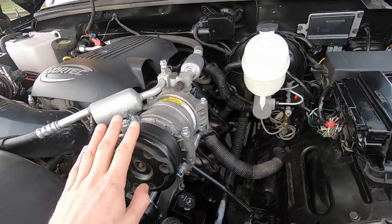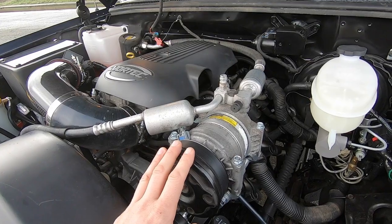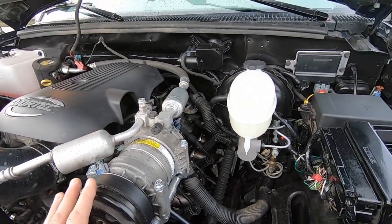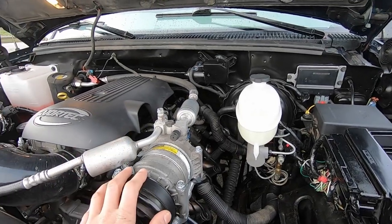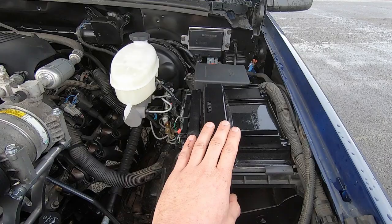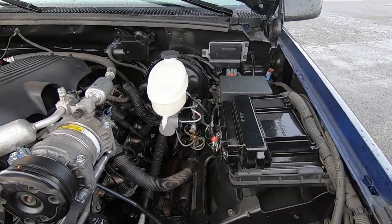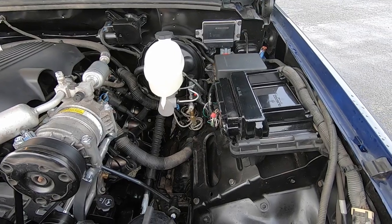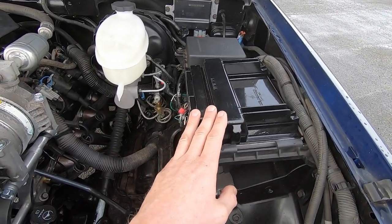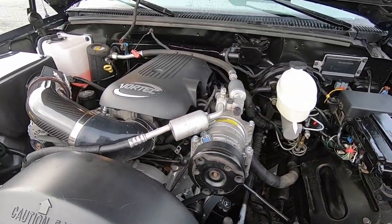And because of the cam, it was idling really low and it wasn't gonna run well at all. If I didn't drop a cam in here, this thing would have ran like a champ right out of the gate, wouldn't have had to do anything. Because of the truck Norris cam, I did have to get this pre-programmed. It also helped with my speedometer because I told them the tire size and all of that, gear ratio. So we got all of that just shipping off. I still need to dyno tune this thing to really get it perfected out. But needless to say, it runs.